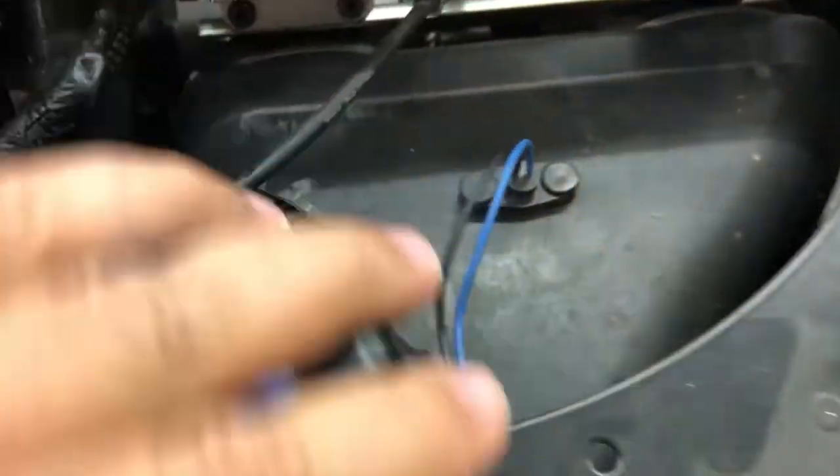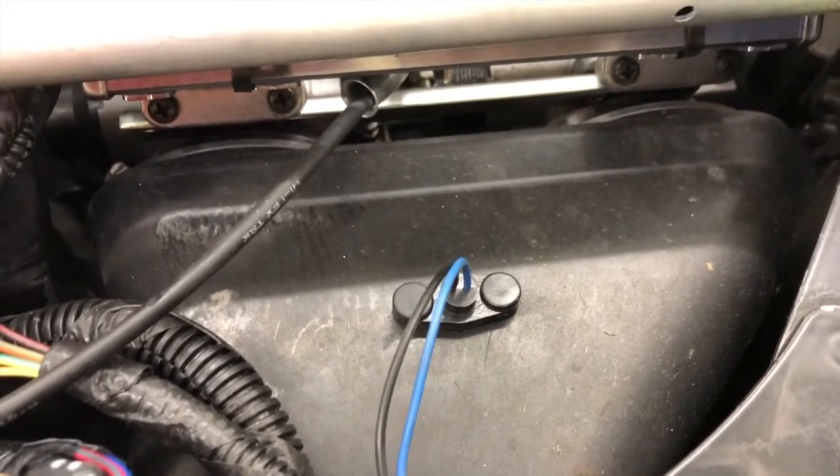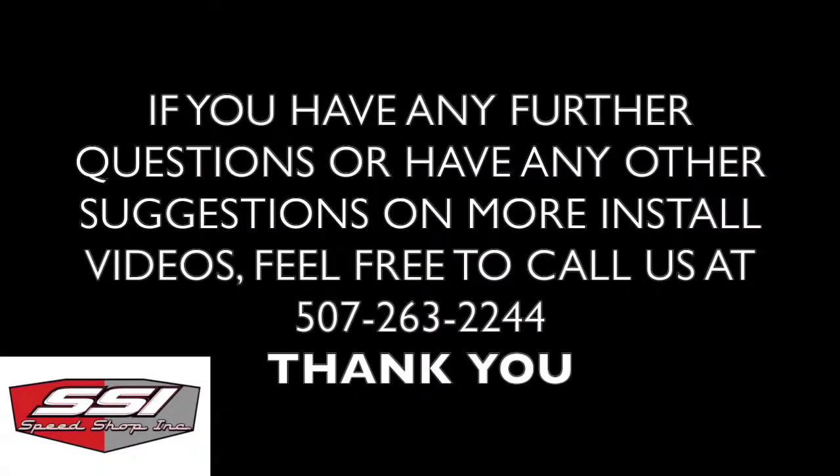After that's been done, you can just attach the plug-in for the air temp sensor to the harness. You can see it's completed — usually just keep the sensor right in the middle in between the throttle bodies. Once that's done, you can reconnect to your ECU and hook everything back up.